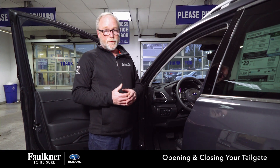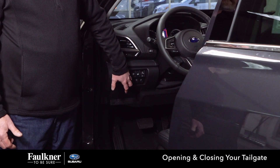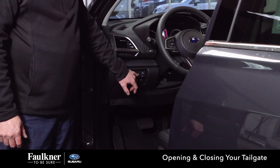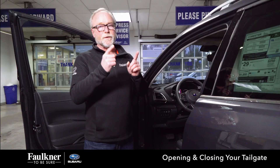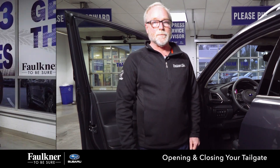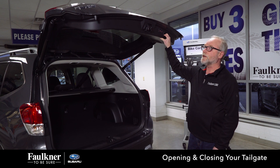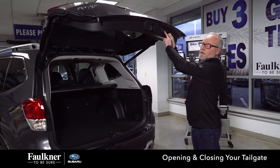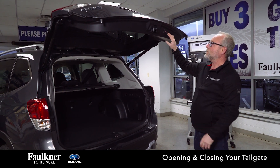We can also set a memory for the rear gate. To do that, the car must be turned off. Open the gate from the dashboard. When that goes the whole way up, press in the memory button and then go to the back to finish up that setting. Grab the handle and very slowly pull it where you think you need it. Press and hold the close button. When you hear that long tone, that is your new memory setting.